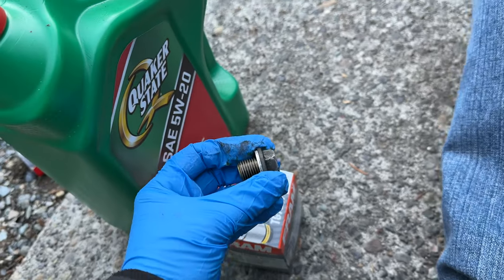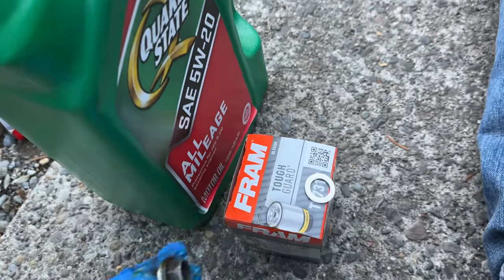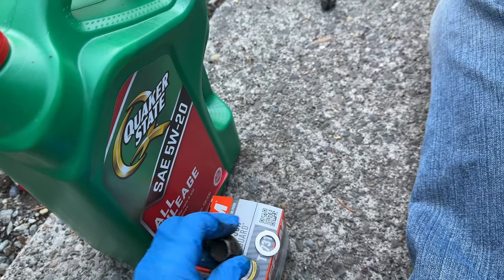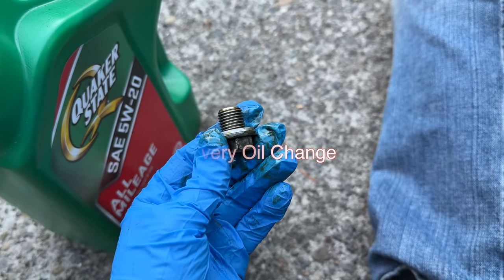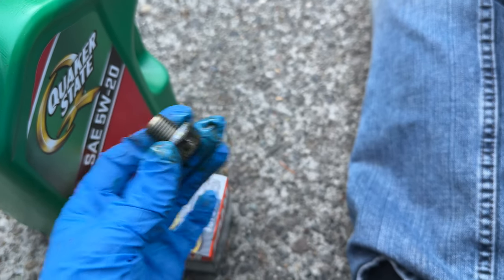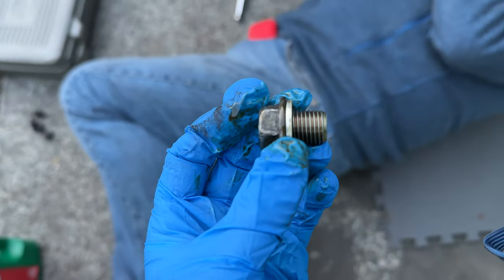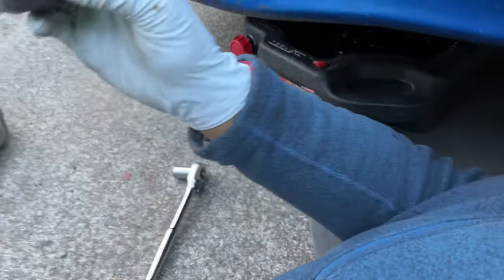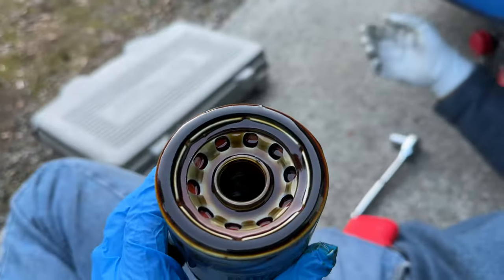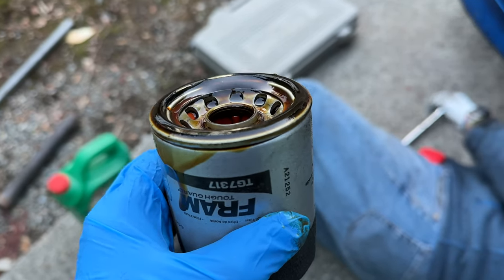Dennis has pulled the drain plug out — this is what it looks like. I'm going to wiggle the drain plug washer off. The old washer comes off and the new one goes right on. That keeps you from getting those pesky oil drips and having to worry about being low on oil. I recommend you replace your crush washers regularly — if not every oil change, every second oil change. Also, while you're doing this, check that your filter gasket came off with your filter. If it didn't, that's not good — you'll double-gasket your engine and end up with oil on the ground when you start your car.